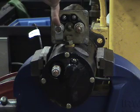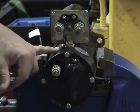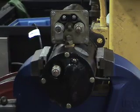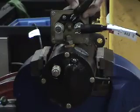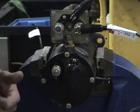The M terminal, or motor terminal, directly feeds into the starter motor itself. Inside the starter motor, it can be either series-wound, compound, or shunt-wound. The ultimate ground exits through the ground strap. During on-vehicle testing with the starter installed, we take our remote start jumper button and go from the battery positive to the S terminal. That allows us to control the supply of current to our hold-in and pull-in windings, allowing us to activate the starter motor.